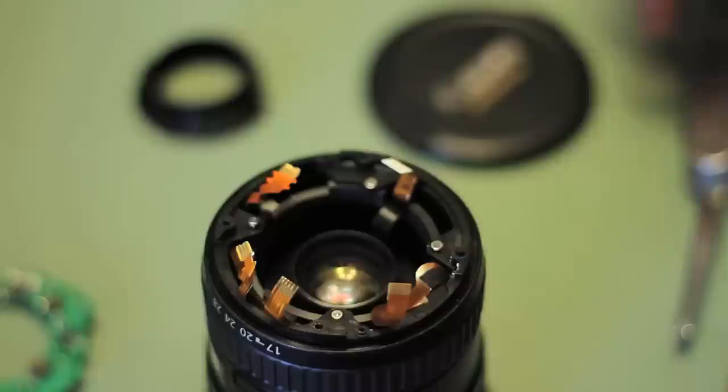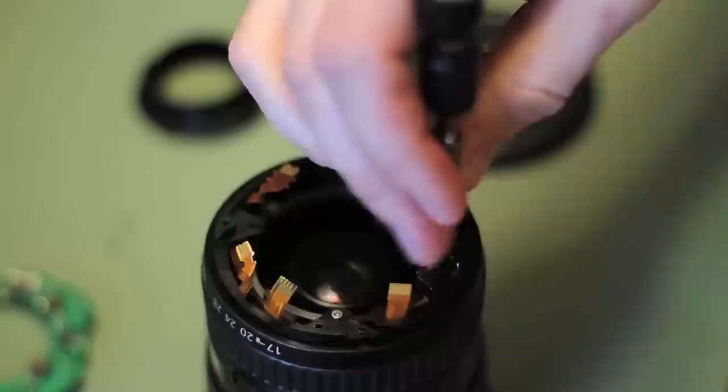Set it to the side. Now if your two screws are rattling around inside your lens and your zoom band is loose, you may be able to dump your screws out at this point because they may just be sitting inside the lens here. You can dump them out and you may not have to go further and take apart the lens. I took apart the zoom band right here — I took that right off from these four screws and then I found the two screws that were rattling around deep in the lens and I could screw them back on. So here's taking these four screws off the zoom band. You may be taking apart your lens further.